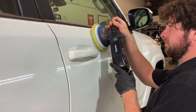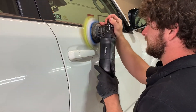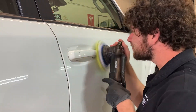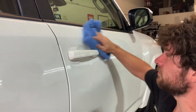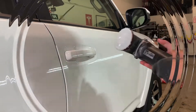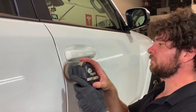So I just went around and cut. You won't really get much out with just foam on door handles — even though I do a lot of one-steps, it does not work that great with the door handles. First step: compound and microfiber pad like you saw before, and now I've got my yellow foam cutting pad going over with Shine Supply's classic polish to kind of refine things. This being a Toyota, the compound was sticking to the paint so I had to use polish so I could check my work, because I couldn't see anything underneath all the haze.